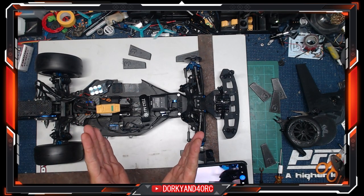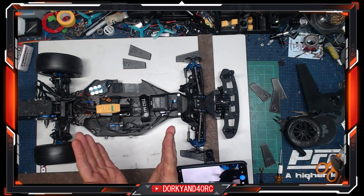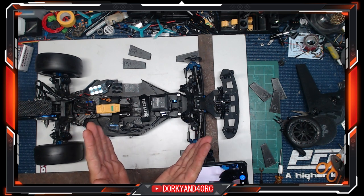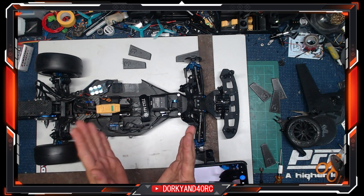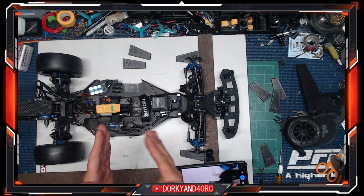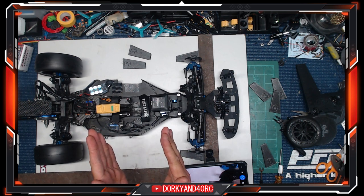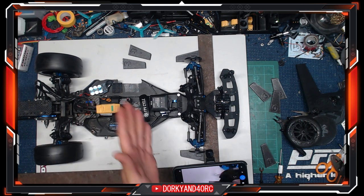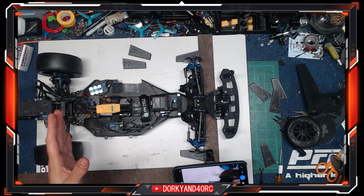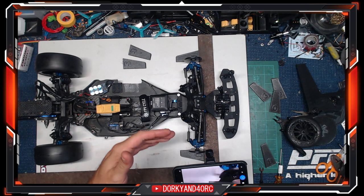If you're running a little bit of toe out and you start to turn one way, you still got the other tire kind of helping pull you straight. Same thing if you turn the other way — that tire over there helps pulling you a little straight. If you're running toe in and you start to turn, you can see that you're going to be sliding and dragging, and that's not going to be any good. If you're at zero and you start turning, then you're just going off track. So it's nice having just a little bit of drag resistance on the opposite tire to help you correct.